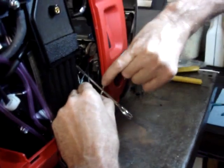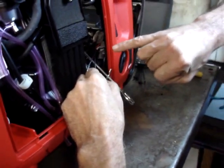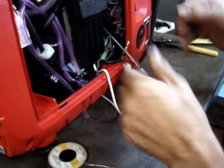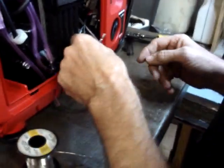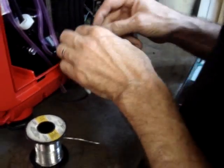Once you solder the joint, just make sure that there are no fine lines in it. That would indicate that you had moved the wire while it was still cooling. If it tapers in real quick, right where the joint is, that indicates a cold joint, both of which are likely to break quickly.